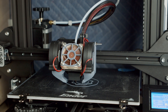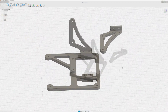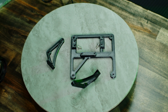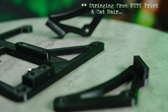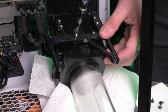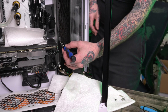I fired up my Ender 3 3D printer to make a new bracket for the reservoir. I jumped into Fusion 360 and designed my own multi-piece brackets. These brackets mount on three sides of the pump and reservoir combination and then mount to the 120mm fan bolt pattern on my 360 radiator at the bottom. This should not only move the reservoir where I need it, but also be a much sturdier mounting design. I made them in three pieces so they could print more easily and also allowed me to make the sidearm brackets more visually pleasing since they'll be visible in the case. I'm personally pretty happy with this bracket setup.